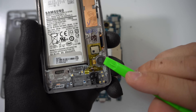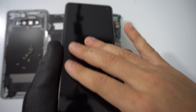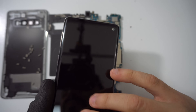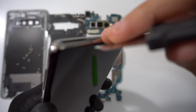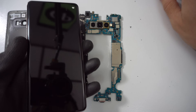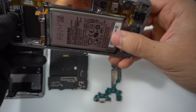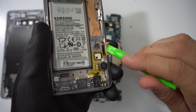If what you want to replace is just your LCD and glass screen assembly, this is the cable right here that connects to it. All we would have to do next is heat up the entire front portion of the screen assembly. You can use a hairdryer or heat gun moving around the screen, or lay it on the hot plate. Once it's hot enough, use a prying tool — it can be a metal one — and give it pressure in between the glass and the frame, going around the entire screen assembly and pulling it up. It won't matter if you break the screen since it's already broken. Then place the new screen where the old one was and slide the flex cable through the opening.